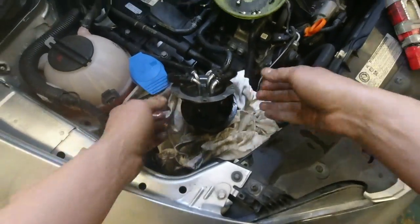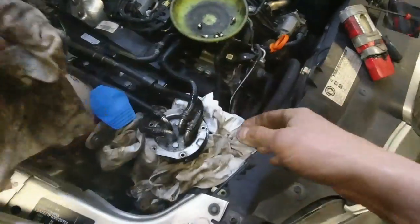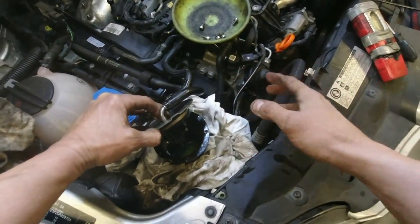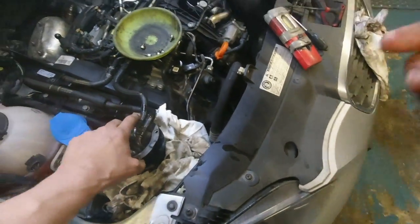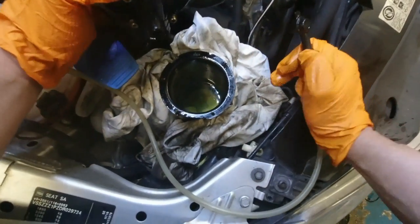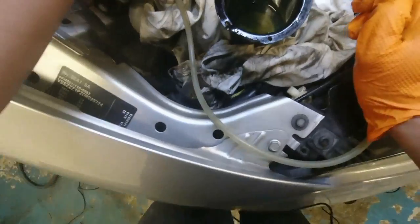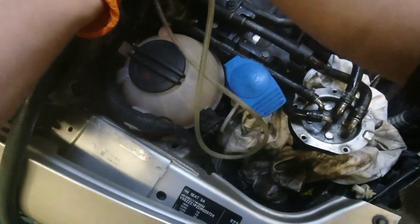We'll show you the specifications of these pumps. We just need to make sure we don't get any diesel all over the place, because you definitely don't want diesel onto your timing belt cover, auxiliary belt, or anything like that. So a wee bit of care is required. Filter's out — let's look inside for any metal fragments or debris. I'll clean this out and suck that diesel out.